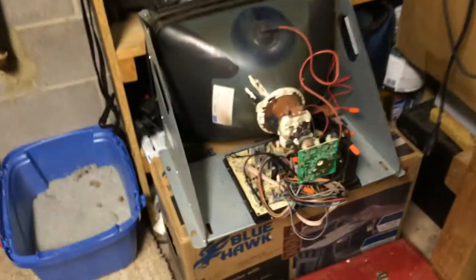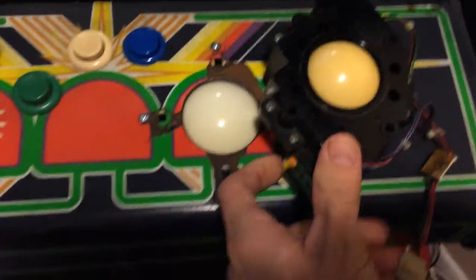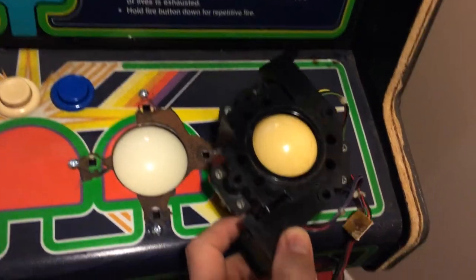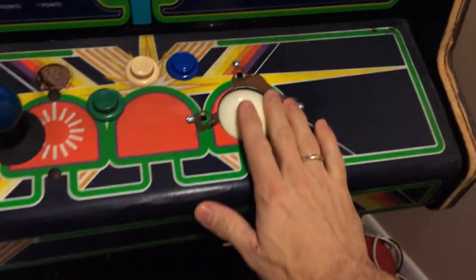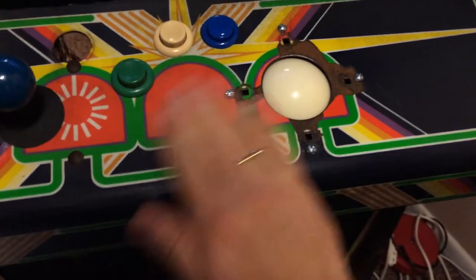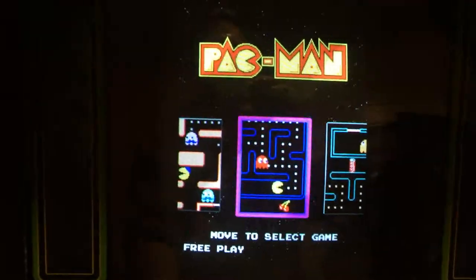The centipede originally came with a 2¼-inch trackball, but I'm using a 3-inch trackball that I had. Here's the original one that came with it — the bearings are kind of shot, so I saved that. I mounted the 3-inch under here with some washers so the ball fits just right, and it rolls really nicely. It works really well with the 16-in-1 and the Arcade SD.